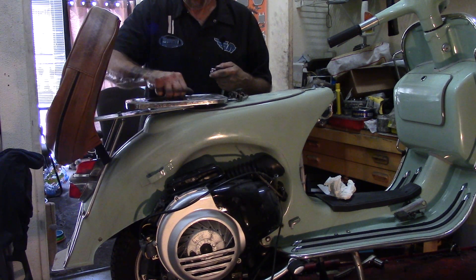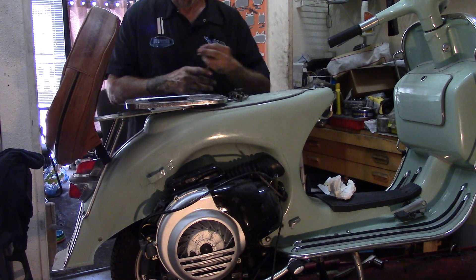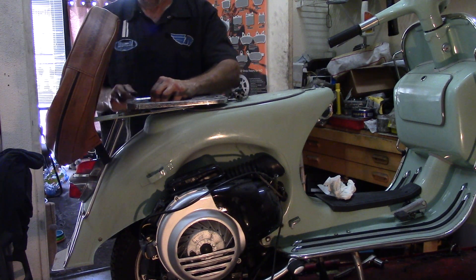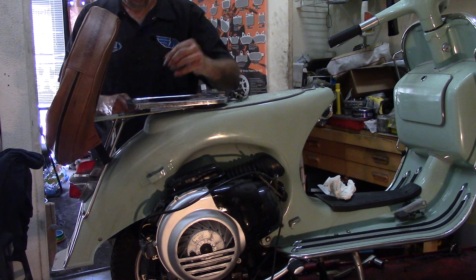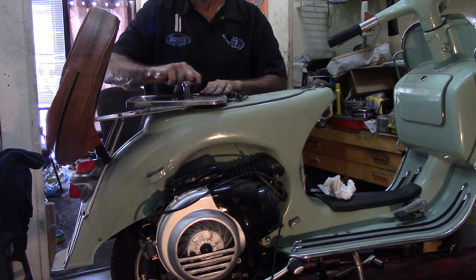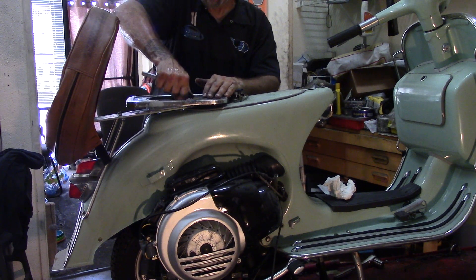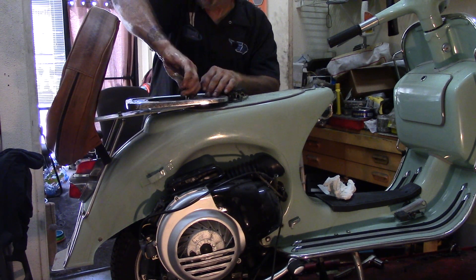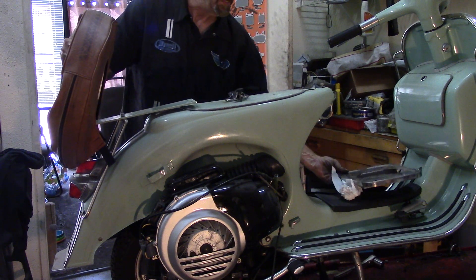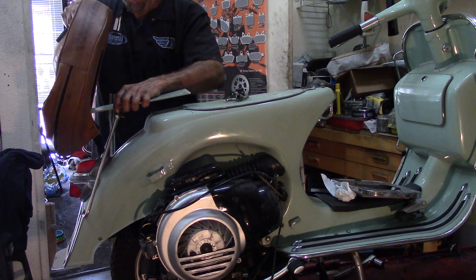I'm going to get a little detailed here, so please feel free to fast forward — but for those of you who are going to do it yourself, you might want to continue watching. After you remove the three bolts that hold the plate to the gas tank, there are two more bolts that support the spare tire. I've already removed those. We take off this plate that's the base of your rear seat. There are two bolts here with nuts holding them on — I've removed the nuts already — then you just lift it away.